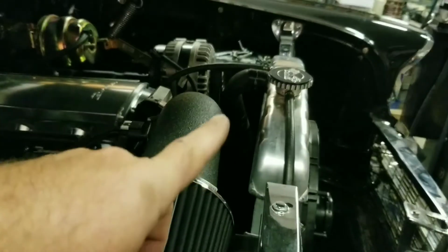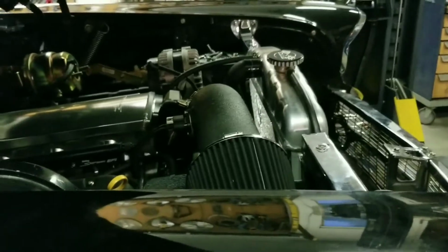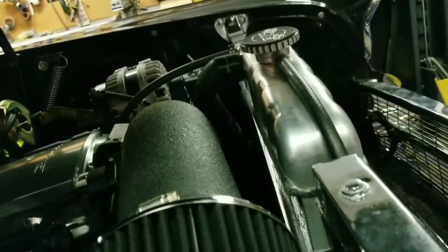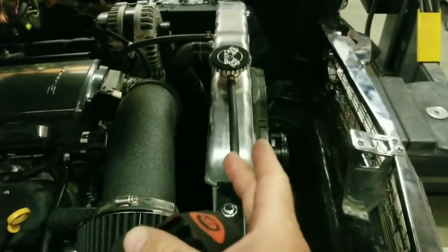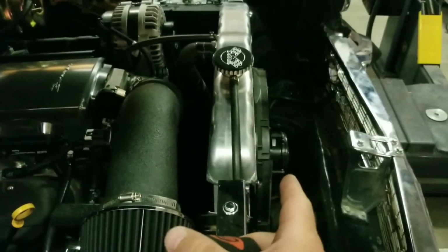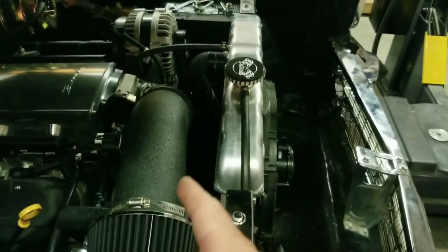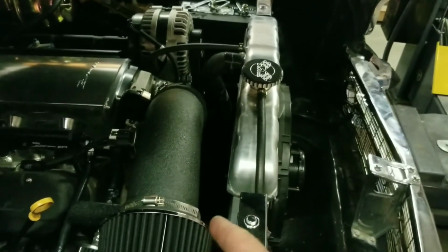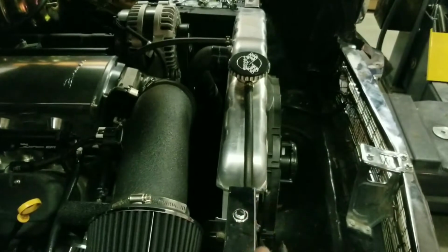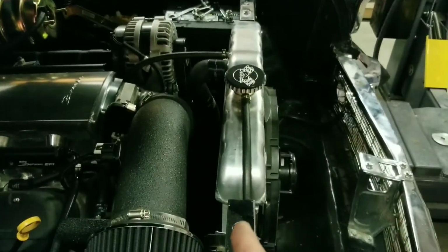Radiator hoses. I had to buy maybe like 40 radiator hoses to actually get some that fit pretty well. And that one's still not perfect, but it was as good as I can get it. So something to do with the 6-cylinder car. Crazy enough, the V8 conversion is made for the 8-cylinder cars, but not the 6-cylinder cars. So something to do with this radiator support is different.